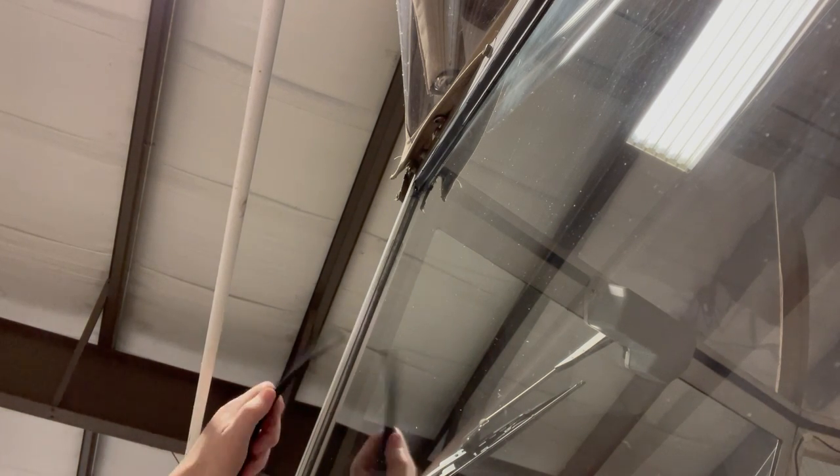All right, it is day four on the windshield project, the reseal. I have one window left to do, and then we'll show you the finished results, which look amazing. Got the piece cut for the front of the side window. This is the last piece. So we're going to put in a bead of silicone, and then we'll put the rubber channel in place.